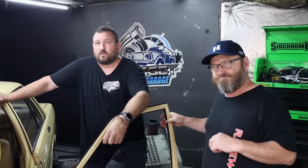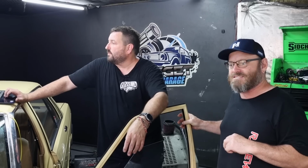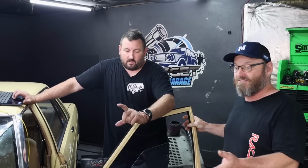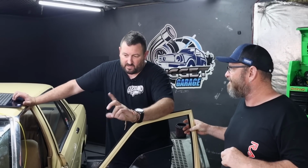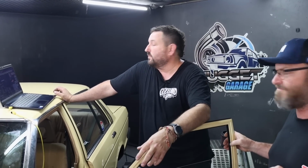We went through this with the Bedford, and also the VL. We did the same thing. I think pretty much everything can do it. Yeah, some engines are better than others. With the reluctor sensor too, the faster you spin the engine, the amplitude of the wave changes, and it can change where your trigger point is.